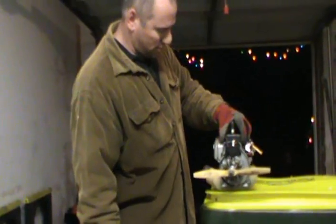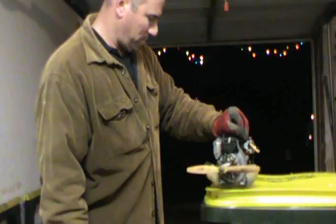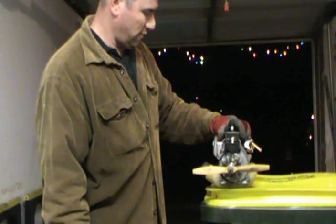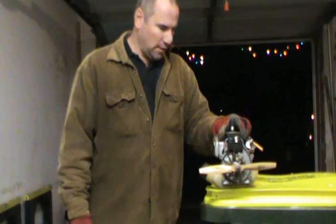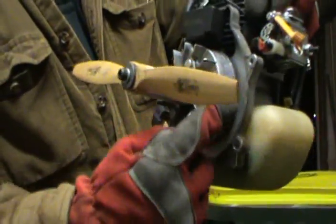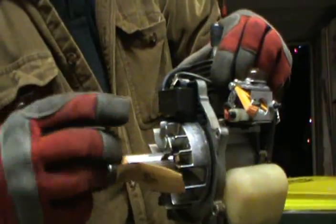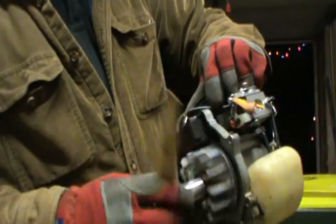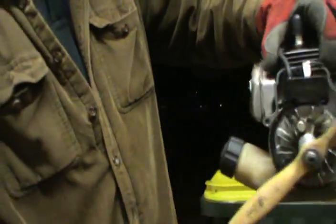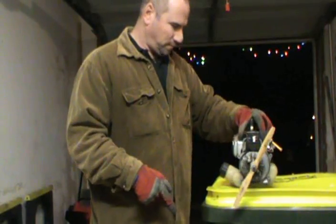I've been wanting a large-scale RC plane, so I got my hands on two weed whacker engines. Right now I'm converting one for an eight-foot wingspan Piper Cub. I had to make a custom prop adapter. I didn't do anything with cutting off any fins or excess aluminum yet — I hear this stuff's kind of brittle and you can really mess it up. I still have the stock exhaust but I'm looking into making a custom muffler. Still have the choke lever, kind of nice for cold weather starts. The tank — I don't know, I may use it or I may not. This is not the safest thing to do; this should be mounted.